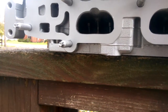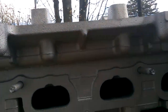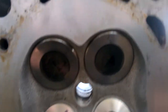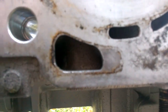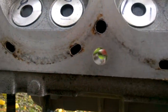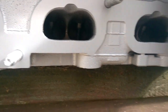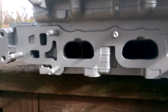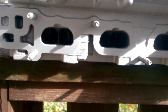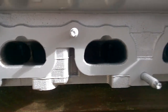If you are doing a full racing port, get with a machinist and find out what you want to do, because I'm going to show you guys something else which, if you don't know it, it's going to help you. You can see where the coolant passages pass through the head — the coolant actually passes over all four of the intake and exhaust ports. Part of this is it helps heat the incoming air charge on the intake side, because the coolant's at 195 degrees Fahrenheit. On the exhaust side, it helps cool the exhaust gases and prevents you from burning a valve or splitting your cylinder head. That's something to take into consideration when porting, because if you take too much metal out of this head, you do run a risk of cracking a port.